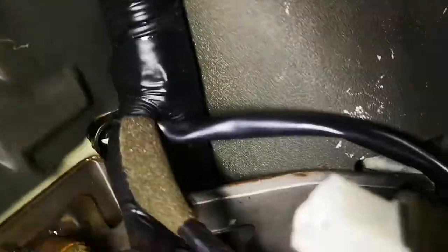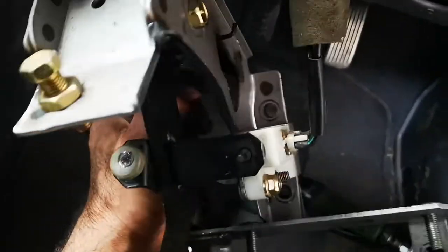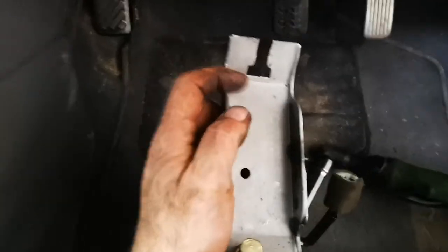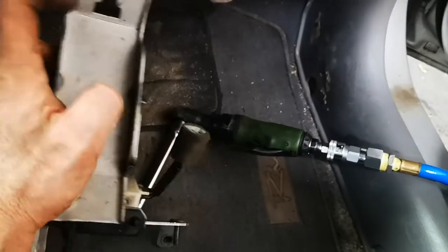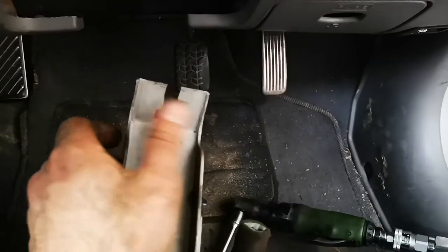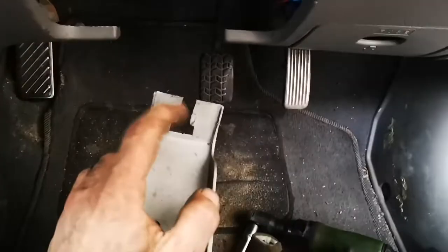Try not to remove the dash — get up from here. You can see it there. Don't confuse it with the accelerator one, that's over there. What they've done is put a little notch, so you can get your finger in from this notch. You can just undo it with a tiny ratchet — get the ratchet in even though the vent's right across there, loosen it, undo it with your finger, and then it stops on the paint on the stud. I chose to remove it and I'm happy I did because it was quite a battle to get out.